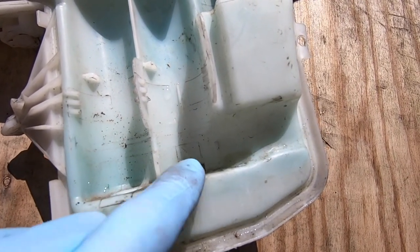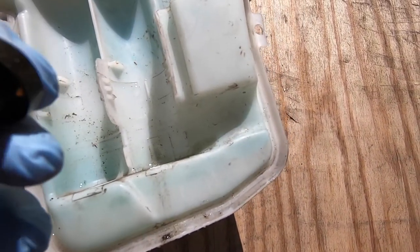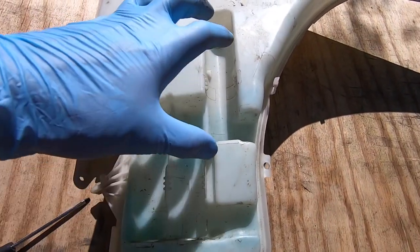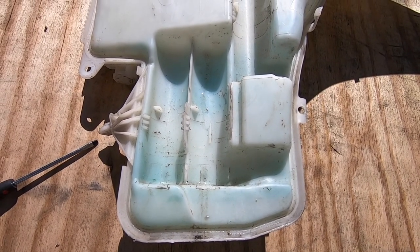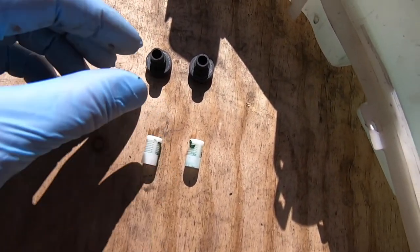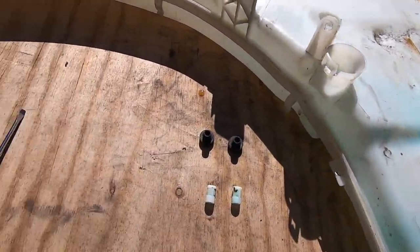On this side, the strainer is still stuck in the hole — we'll remove that now, might need a screwdriver to prise it out. The strainer pieces have come off and are sitting inside, so we'll need to feed them out through the hose connection hole. Once we've got them out, we'll give the reservoir a good flush with some really warm soapy water, a good rinse, then flush it out with a hose pipe. We'll also give the strainers a good clean, then piece it all back together. After a bit of messing around, the two strainers are retrieved — there's a bit of slime on them, they're not exactly fully clear. We'll give them a good clean with hot soapy water, same with the rubber bungs.